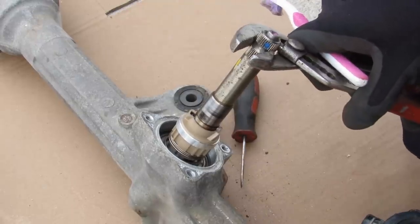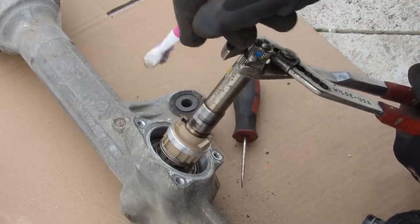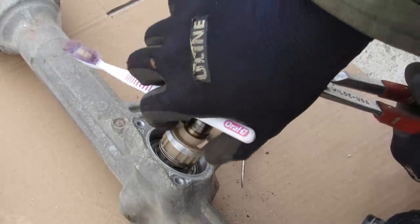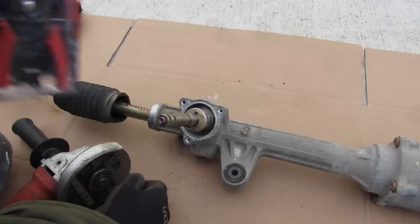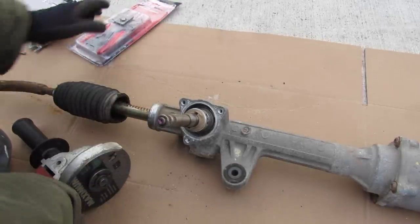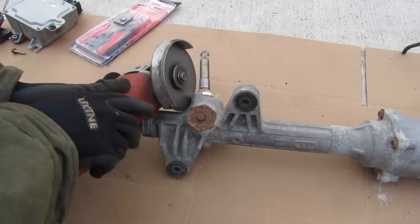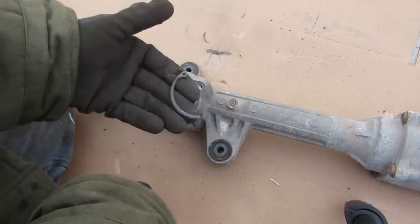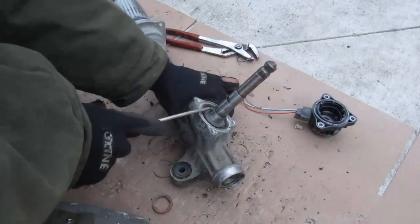You can see at full lock to the right how that ring moves — it's got these two slanted little channels. As I rotate it, it tries to twist, but instead of twisting it kind of brings it up a little bit. Next up there's a snap ring inside of here that I need to remove. My manual snap ring removal tool doesn't really work so I'm going to have to use my power snap ring removal tool. Then there's the snap ring. I'm going to loosen this lock nut and extract this shaft here.